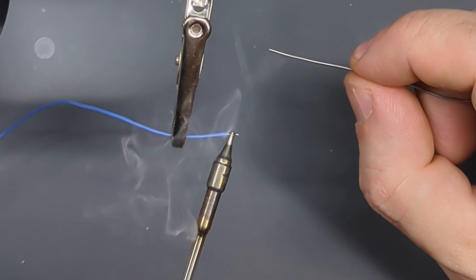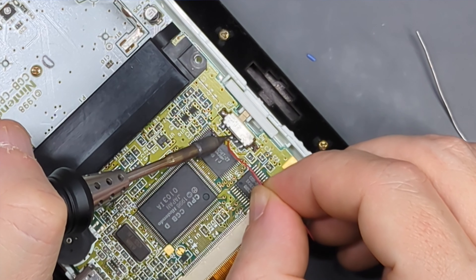I've done plenty of tutorials for all of these different kits, but the question that always comes up tends to be about the soldering. The thing that puts a lot of people off with these mods is adding that wire. Soldering involves adding wires or connecting components together by melting a small amount of metal called solder onto the connections, which holds them in place and allows electricity to flow through the joint. It seems very technical, it looks like it might be quite fiddly, but really it's quite an accessible skill that's easy to learn, provided you are patient and careful. So in this video, I slowed down quite a bit when it came to adding the wire on this build to explain to you how you can learn this technique.